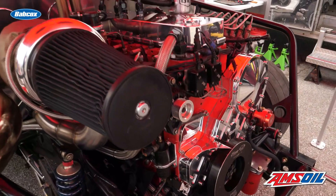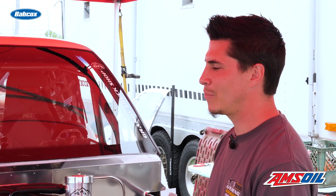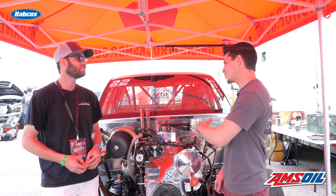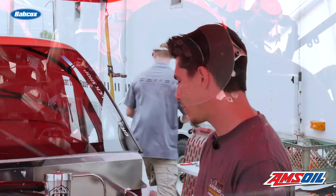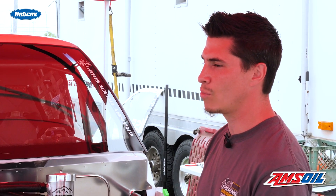So we've got a P-Pump engine — kind of older technology — but it's got a couple different things that are more uncommon. The P-Pump itself is uncommon nowadays, and I understand you're one of three guys running the mechanical setup? Yeah, I think there's only three of us. Our setup is way different than theirs. We originally had a 12 millimeter pump on it, which is the stock size. The pump's not stock, but it had 12 millimeter plungers and barrels in it. We set it up that way because we had a theory it could react to nitrous better and be more predictable. Being mechanical, it's kind of like driving with a light switch — the truck's either on or off — and we were trying to figure out a way to bring the power in smoother to make it stick and still not be down on power.